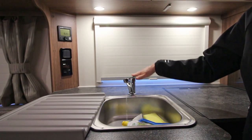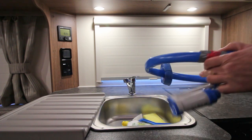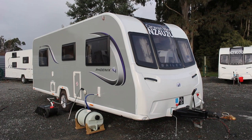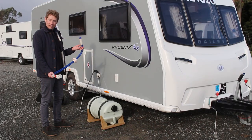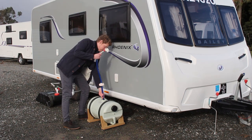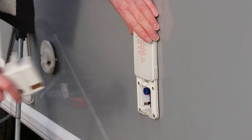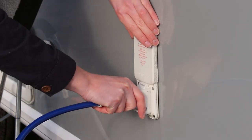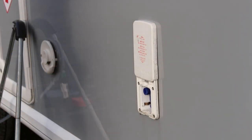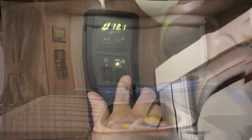Connecting your fresh water system will supply you with running water to your sinks and shower. To do this you will need your blue fresh water pump and your grey fresh water barrel. Once the fresh water barrel has been filled with clean drinking water, you can drop the end of the blue pump into it and then connect this to the caravan by sliding up the pump shield. It's important to lift the pump shield again before removing the pump. The pumps and their connections can also be round depending on which model of caravan you have.